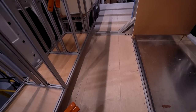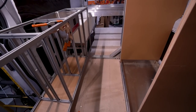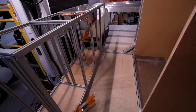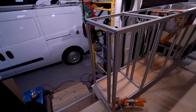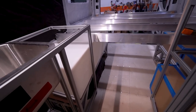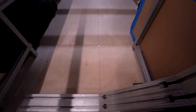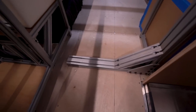You can see this pencil line down the floor — that's the center of the van. You don't take your measurements off the side walls. These vans taper; each platform tapers in a different way. This Sprinter bows outwards towards mid-ship, then comes back in towards the tail. So you've got to do a pencil center line all the way down. Look at those screws — they're dead nuts on the center line. That's where you work. You work off the center line.